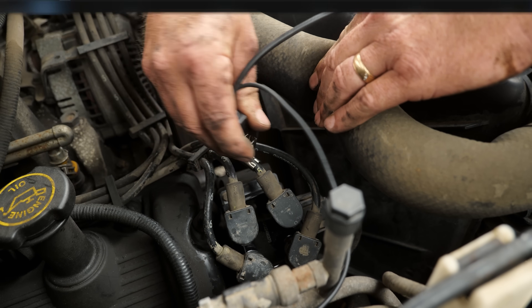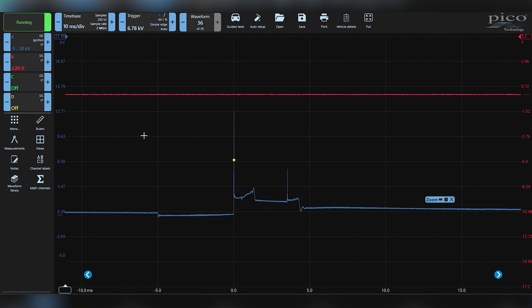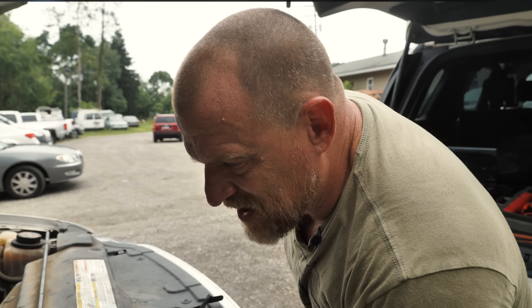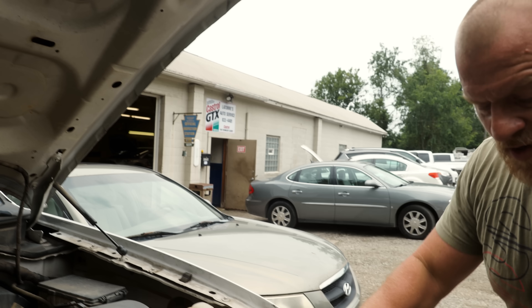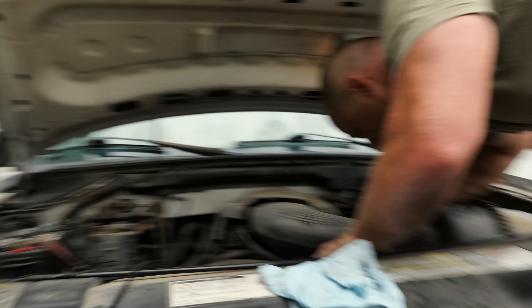So under five. Oh no, that one looks shitty too. I believe this is my guy that's arcing. Let's see if we can match the arc to the waveform. Listen to this. There it is — I heard the arc. What cylinder was that? So that's the first one up here and it did sound like that too. Let's see if we can see something. Five and six are our two misfiring cylinders.